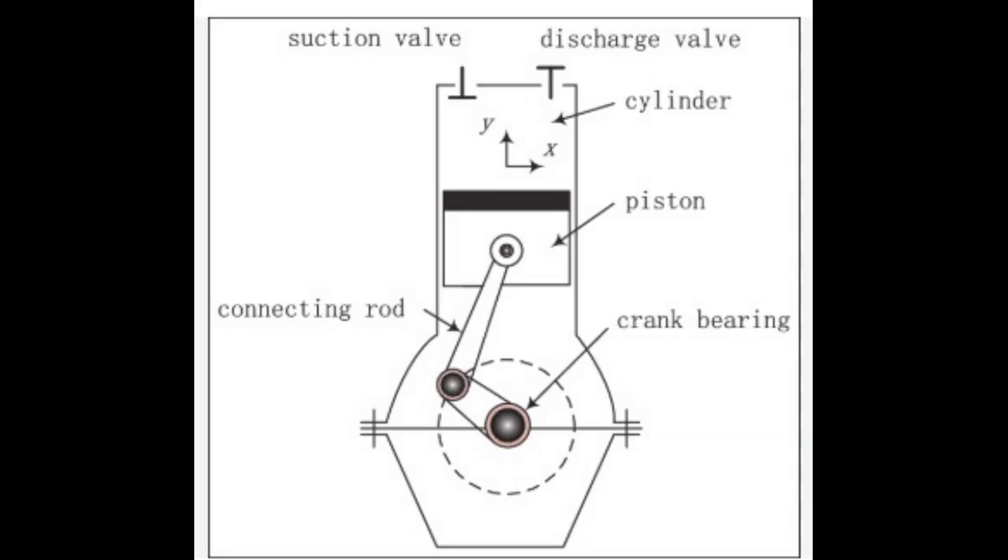The final part related to the speed of the exhaust pulse is the RPM of the motor. As the RPM rises, the piston is moving faster and pushing that exhaust charge out faster, so the velocity of the exhaust charge increases as RPMs come up. This is part of where we come into a compromise — tubing that is large enough to flow the exhaust at higher RPMs is probably not the same tubing that is optimal at lower RPMs.